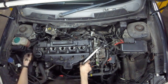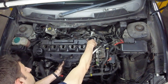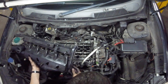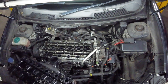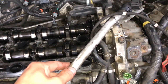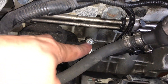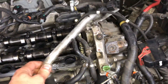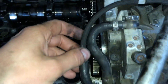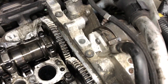I do manage to remove the rocker cover, but I'll show you how the breather on the right-hand side can be moved further out of the way, and also the feed from the high pressure fuel pump. You can move this pipe further out of the way by undoing this jubilee clip here, and if you just loosen this 17mm bolt here you can turn this pipe away from the rocker cover, leaving you with much more room.